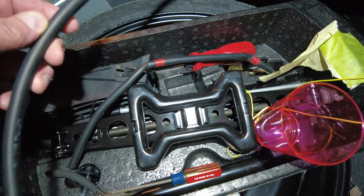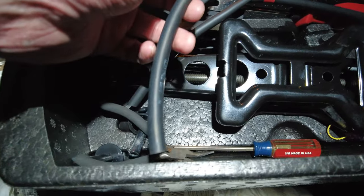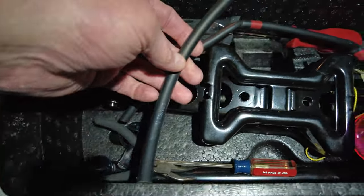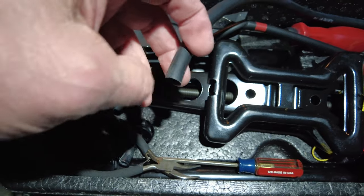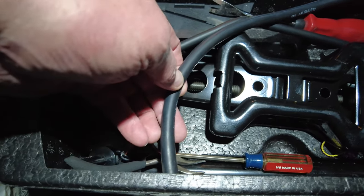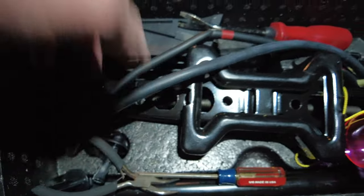Here's the old one — see how it's all kinked up. We're just going to replace it. Put the grommet in backwards. What I was worried about is it being pushed up against the wall like that against the side of the car. I'm going to cut this at an angle so even if I push it in and it hits the wall, it'll still have room for the water to run out.